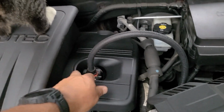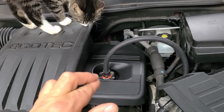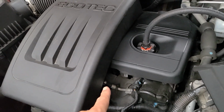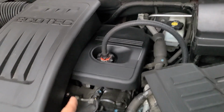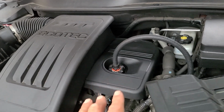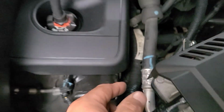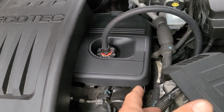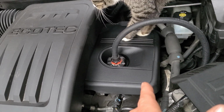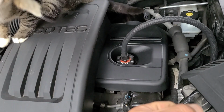this is put in because of the design flaw of these engines, and the major problem that they have is the fact that the PCV hole gets clogged up inside of the manifold there, and what that does, it causes the crankcase pressure to build up until there is a rear main seal down in there between the engine and transmission. The pressure will blow that rear main seal out and will start pouring the oil, not just a little drip, but pouring the oil. It'll empty the crankcase and you will lock your engine up.